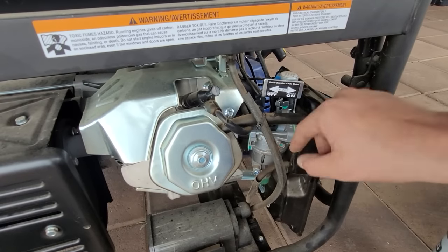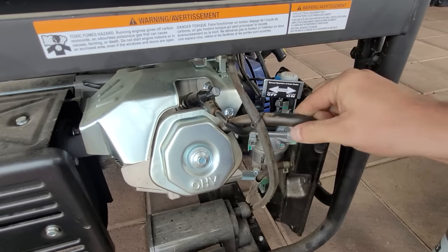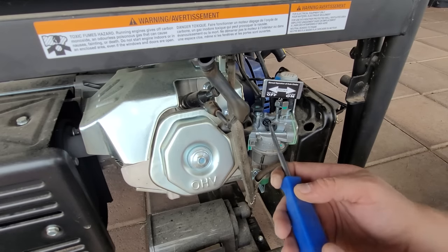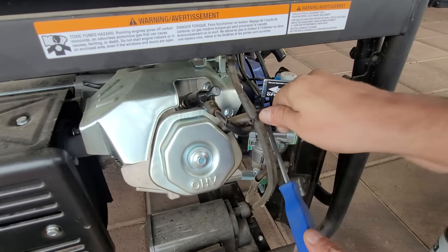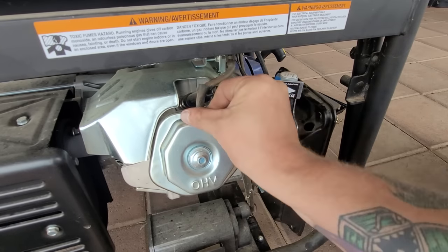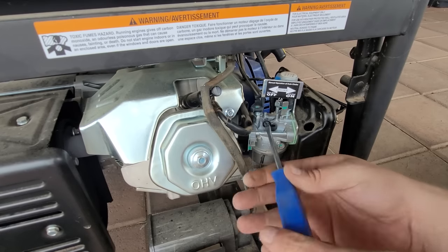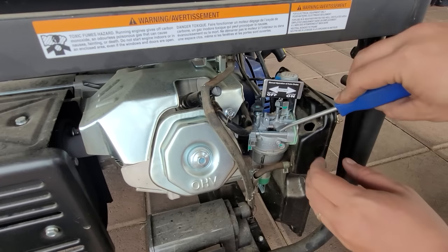Here's the carburetor. It's hard to see what I'm going to work on with these tubes in the way, so I'm just going to remove these tubes to show you where I'm working right here. So what we're going to do is unscrew this all the way out. Now you guys can see a lot better. Just remove your idle. Any kind of carburetor that has this and it's surging — I guarantee it's right here.